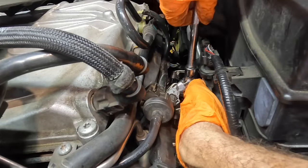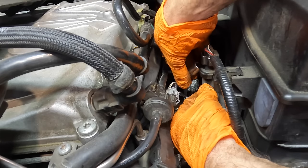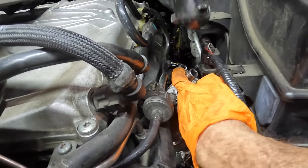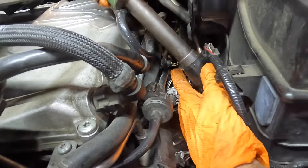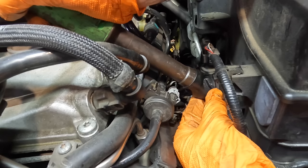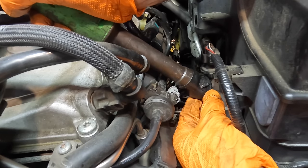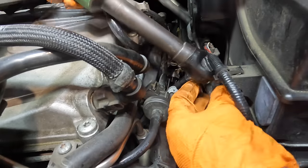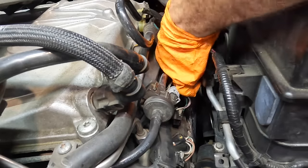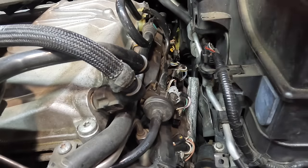Got three more plugs to go. Let's go ahead and get them started — we'll start them up by hand and then go down the line with a torque wrench. We don't want to cross-thread a supercharged Land Rover head, do we? This is why those universals are great — you can get into hard-to-reach places. Remember, these aren't torqued yet, they're just run down until they stop. I didn't put a plug in that one yet — that's silly. Let's see here.